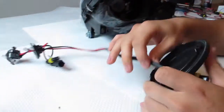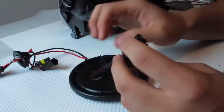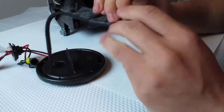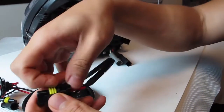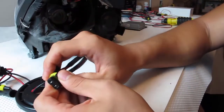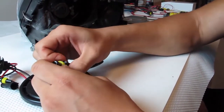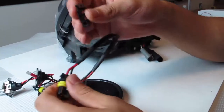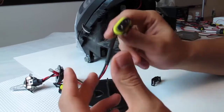And you'll be left with the 9006 connector barely being able to pull through right here. So if that's the case, my recommendation is that, from my understanding, the outer casing of this is able to detach. So I'm going to try to do that right now. So you pull this from the sides. Be very careful not to break it, of course, but it has some flex point that it can do before giving in. So I'm taking this apart right now. Alright, so I removed this outer clipping piece, which fastens the pin wire so it doesn't slip out. This should be enough to clear it.